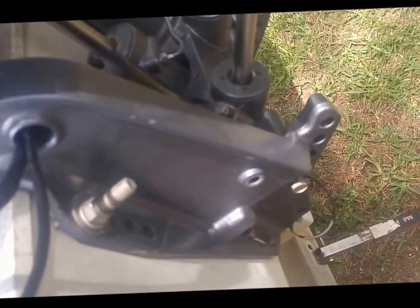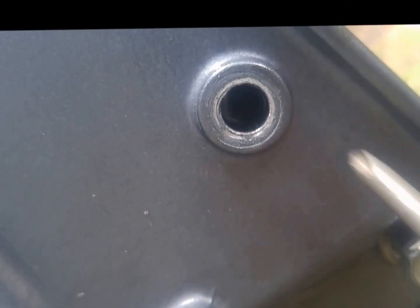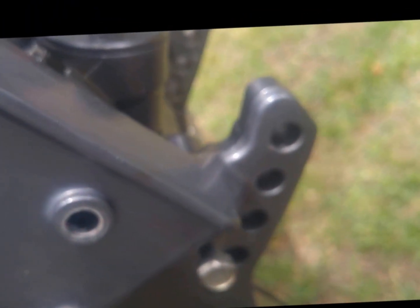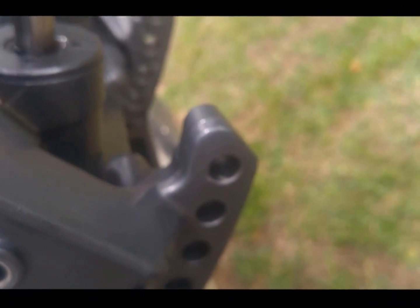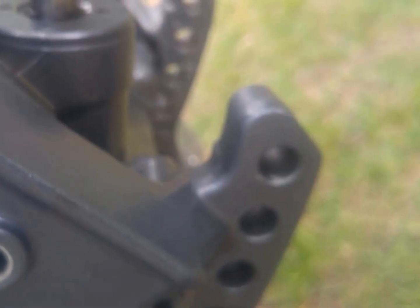They are copy, but things just come to my head as I'm working. So if you didn't already know about using a screwdriver to line up bolt holes, the one thing you need to be aware of is that down inside there, of course you can't see them, are threads. And if you get in there and get aggressive way down in there, you're going to screw up your threads, and then you're going to have a real mess. So I almost take back what I said about using a screwdriver. If you know how to do it, it'll work. You ideally are using a softer metal. If you have a brass rod, that would be ideal, or aluminum.